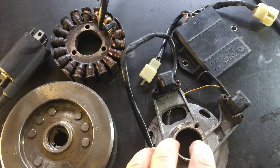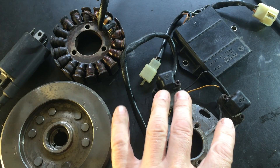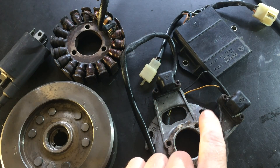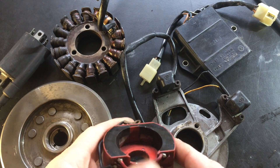The pickup system is way better. You have a larger circumference, so you can adjust the two pickups more precisely, and also you can adjust them independently, so you can adjust each cylinder independently — which you can't with the old ones, where it's a fixed system.